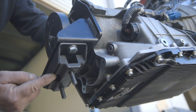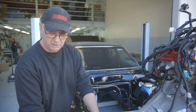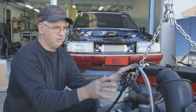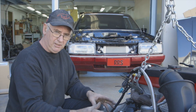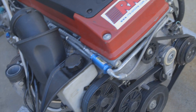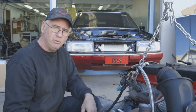We also have a rear gearbox mount adapter so you can use an original early Ford rear transmission mount. We're on the final stages of completing this engine conversion. The merit of this is that you can source a complete power plant with the auto, computer, radiator, power steering pump, and air conditioning for a very cheap price second hand. From there you can upgrade to major power without even opening the engine.